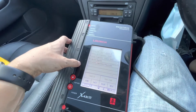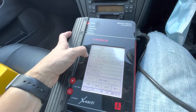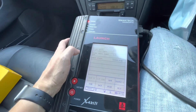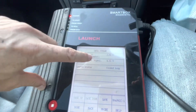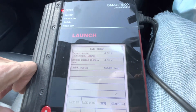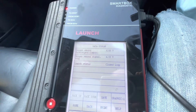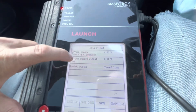I just wanted to show the figures I'm getting for the O2 sensors — the voltage — so you can see them if you're trying to diagnose a similar issue on your car. Looking at the parameter display will help you sort out your issue, or confirm if you need to replace them like I did. The sensors fluctuate between five and zero volts. The previous cheap ones were reading below two volts or just zero, so they simply weren't doing the job.